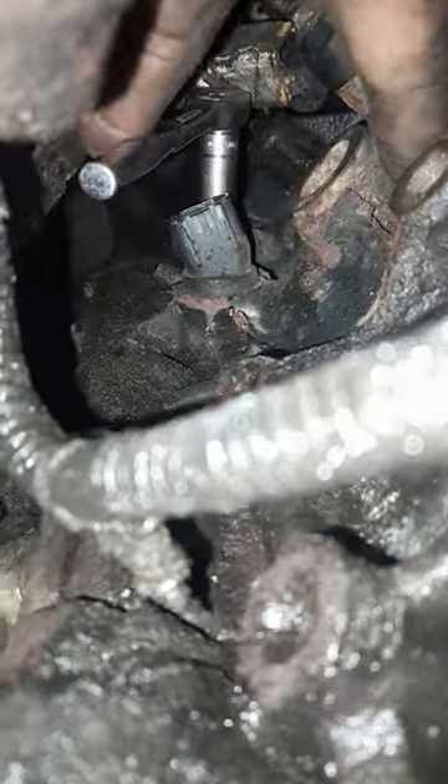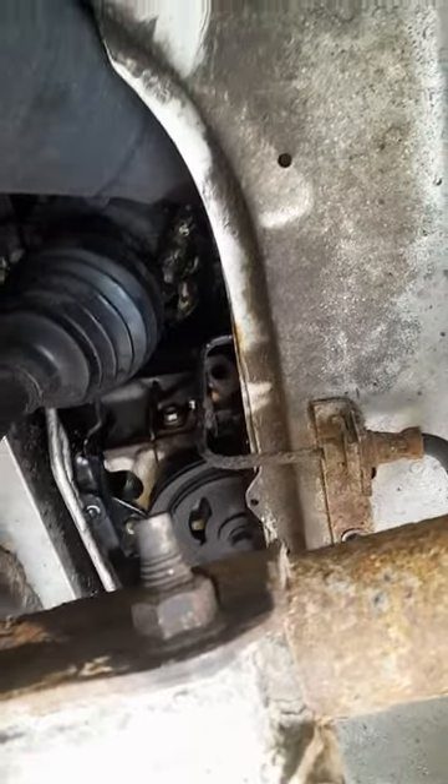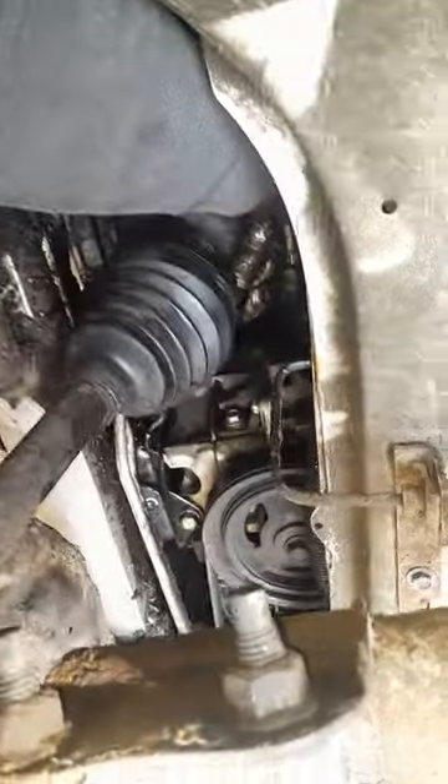Back up in here — not too crazy. There's a bolt on the other side of that crankshaft sensor. You need a deep socket 10 millimeter, and go ahead and take that bolt off. You'll probably need a quarter inch 10 millimeter socket. You're gonna have to be in an awkward setup — I'll show you where my arm is, I'm in there like that. You're gonna have to ratchet that on out, then take that 10 millimeter bolt out, and I'll show you how to get that crankshaft sensor out.